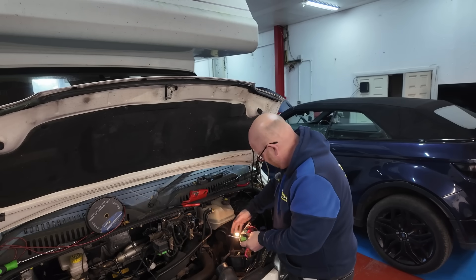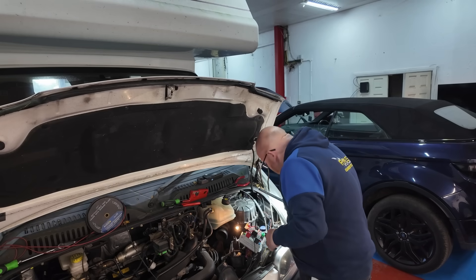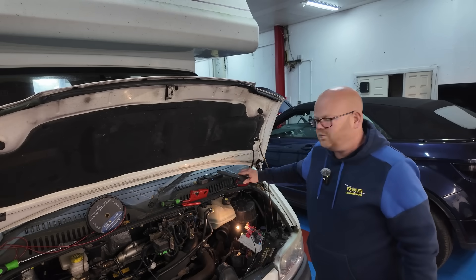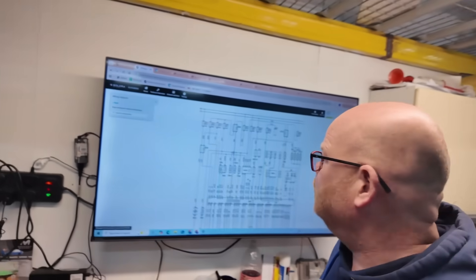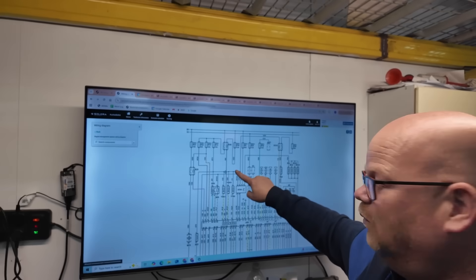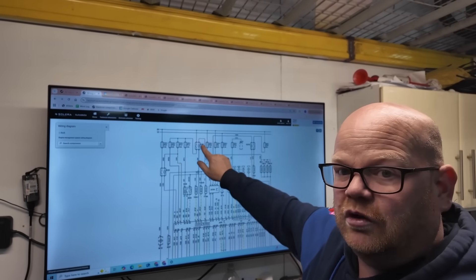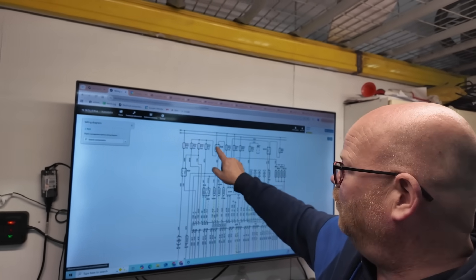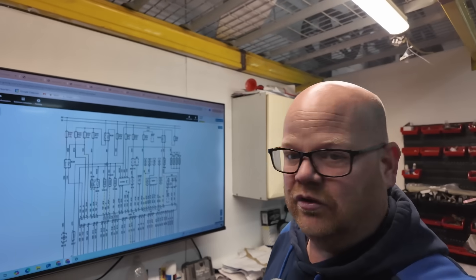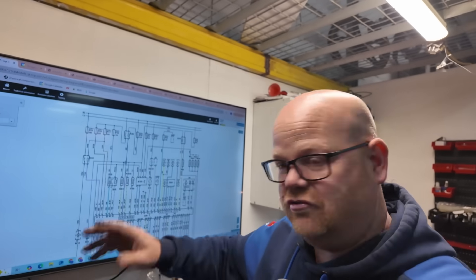So that's all disconnected and yes, it is going down that plug - which eliminates a lot of other things. Let me show you what I mean about before and after the relay. It's this fuse, going in here where we know we've got a short on one of these wires. Moving multiple plugs could turn the relay off and then we'd lose the earth path, but that's not what's happening here. So now we know we're coming out of that plug, all we've got to do is find out which pin it is and put the bulb into that pin.